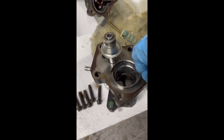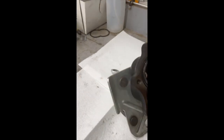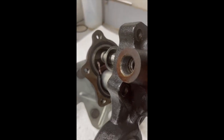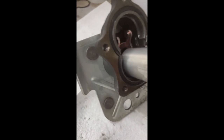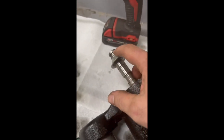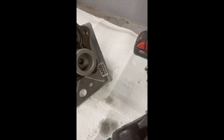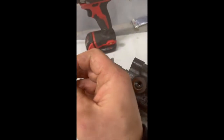Try to get behind it without scarring up the walls of the cylinder — just get down in there and pick it out and bring it out the front. As you go back together with the two pieces, make sure that this groove on the end of the shaft lines up and that the notches go down in between those two pieces so it's all one unit together. You can see those notches right here — they need to ride inside of this groove. Pull everything out as far as it can go, then once it sets down in there it locks it all together. The spring and push rod all have to go in here together as well.